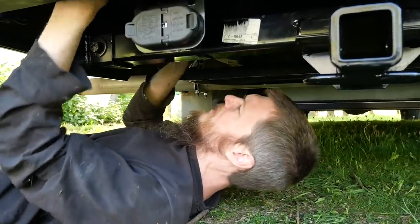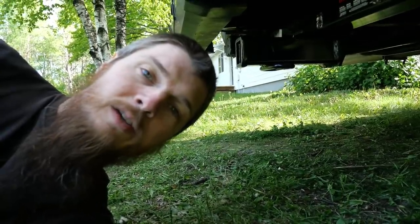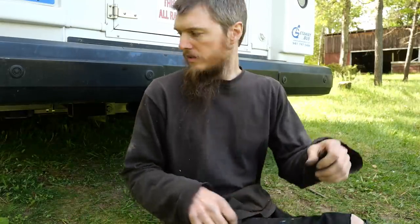I think this is looking pretty good. We're done — that went pretty smoothly and I'm happy with how it came out. Now we can get to towing our trailer with our bus and pick up supplies. The adjustable RV hitch worked perfectly for a bus — I'd definitely recommend it for any bus conversion. Our bus was already pre-wired for a trailer hitch more or less; it had all the wires going back there waiting. I added my own waterproof connectors to hook the trailer connector to the factory wires, but you don't even have to get that fancy. You could use regular crimp connectors, some heat shrink tubing — anything will work. Some vehicles won't have wires neatly waiting, so you might have to tap into your tail lights and use a trailer light controller.